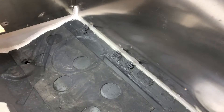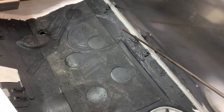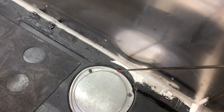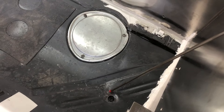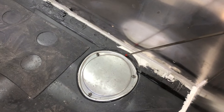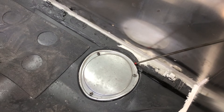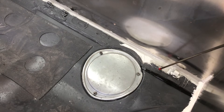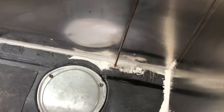An additional point: this seam on some cars looks very tight, but if you look closely at the top and the half-moon shapes, you'll see a little gap. It's surprising how much water will make it up from the low point and seep through into your cab. Take a couple extra minutes and seal that up really well. You may have to take the cover plate off to get that seam properly. Also make sure you cut or break off the little tabs from the harness protector and fill those holes — there's one about here and one about here. Get all those holes filled.